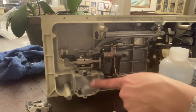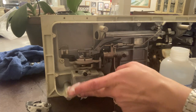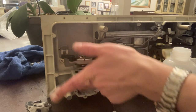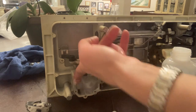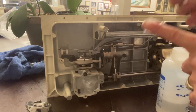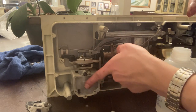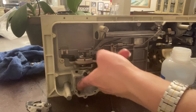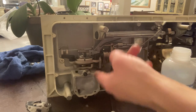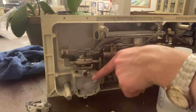I had a Juki — I still have that Juki — it's an industrial machine, so it operates incredibly quickly. It started overheating like crazy, and I bought it used. When I'd take out my bobbin it would burn your hand, that's how hot it gets. It turns out my gearbox was completely empty — there was nothing in it, and it was causing friction of the metal because it is running like 6,000 stitches a minute or something. It was causing it to just burn up. Ultimately I had a problem and had to replace the whole shaft. So you want to make sure that you have grease.